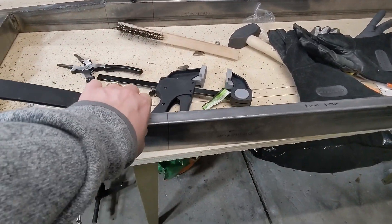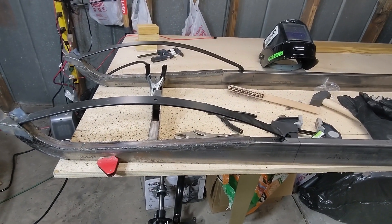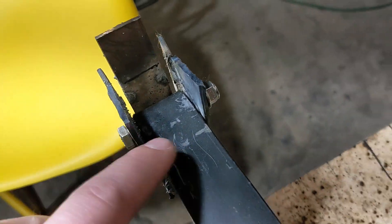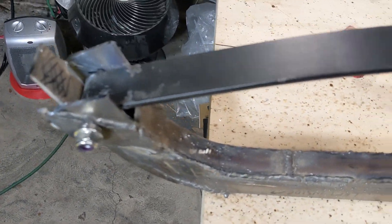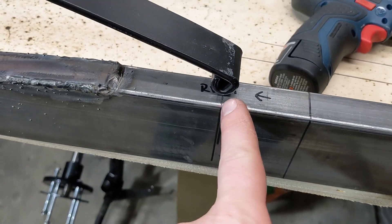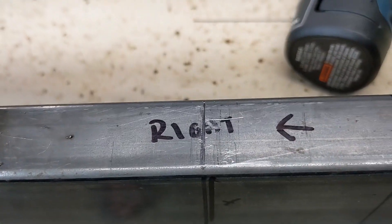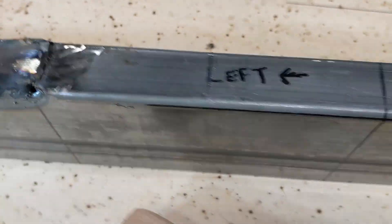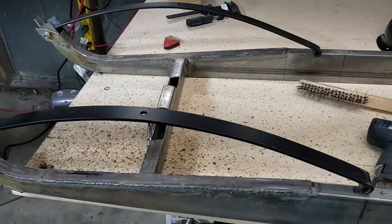I've got a mounting bracket for this already — it's in a little baggie. And then yeah, I can flip this thing over and I have a rolling chassis. I have the leaf springs mounted temporarily. I was trying to scribe out the center line and I was having trouble with that, but then I realized the springs will scribe their own line right in the steel for you. So that's what I did, and that works out really well. I recommend using the natural scribe line if at all possible.